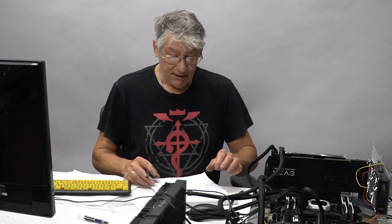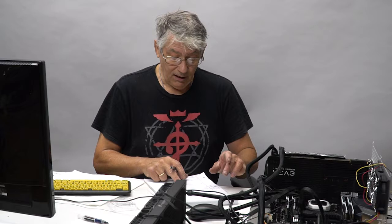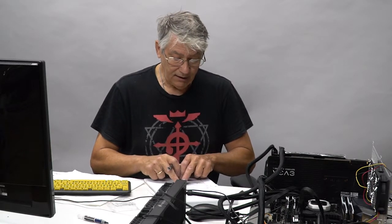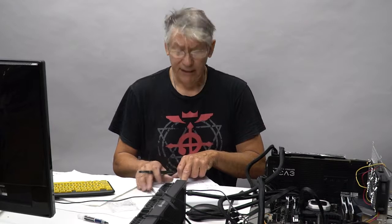And the reason I had the AVX backed off is because even with that, and at 4.1 gigahertz, my highest core temp was 98 degrees Celsius. That is way too high. We're a few degrees away from thermal throttling, and certainly too hot for a daily driver. But I wanted to see how far we could push it and keep running.